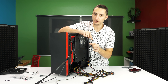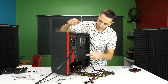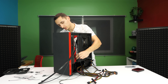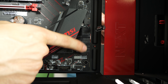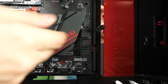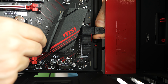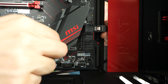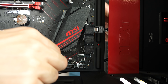The other end of the SATA cable actually plugs into your motherboard. You can route it any way you want from the back. The other end of the SATA cable connected to your SSD or hard drive gets connected to the SATA ports on the motherboard. I typically plug it into the top one, but you can choose whichever you want. Just flip it on its side and insert it — if it doesn't go in, flip it to the other side and push it in until it snaps.